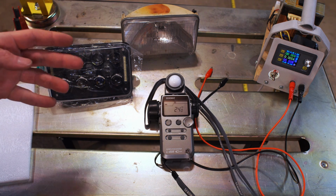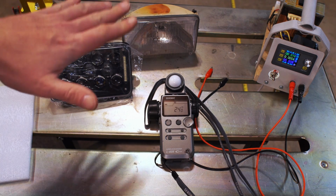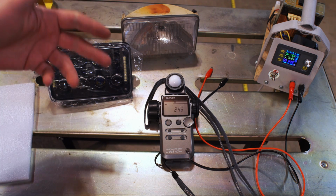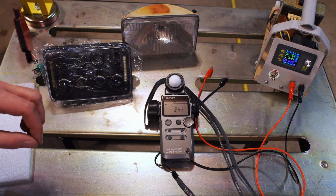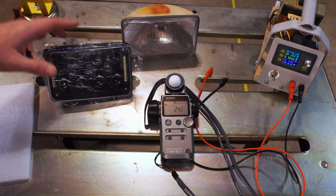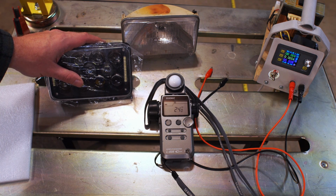It's important to note that most older lighting systems do not have relays in them, so all the current runs through the headlight switch that you pull out, and there's a lot of loss. In the LTD, however, I've rewired the whole thing, so it's running through a relay. There's 12 gauge wire running to the headlights, so it's an absolute best case scenario. Before I did that, I was lucky to see 11 volts at the headlights. Right now the headlights actually aren't dim, but the problem is I lost a high beam and they're getting kind of hard to find, and these better ones have come down in price to a point that's reasonable. There used to be one that was sold by JW Speaker.